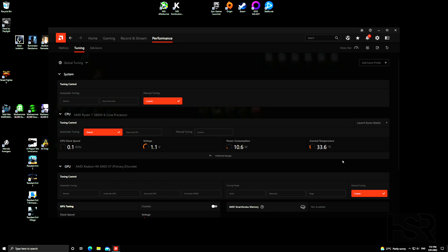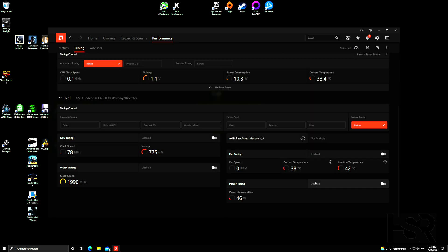What I'm going to show you is custom manual tuning, and this is where Kombustor comes in. When we customize settings, we use Kombustor to stress test and verify it's actually stable. It has a built-in safety feature — if it overheats or there's any danger, it shuts everything down, the screen goes black, and all settings reset. So expect crashes during this process — that's completely normal.